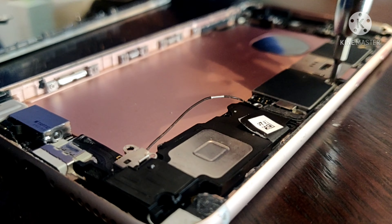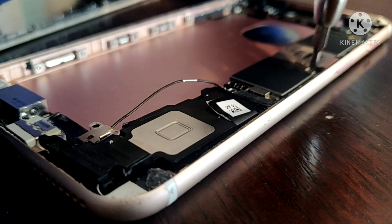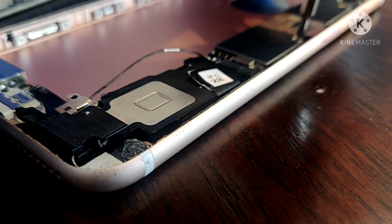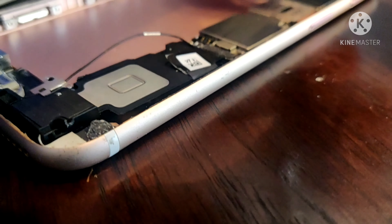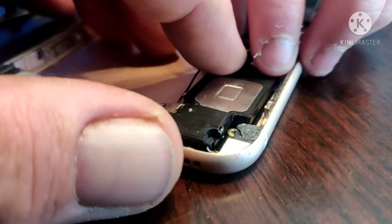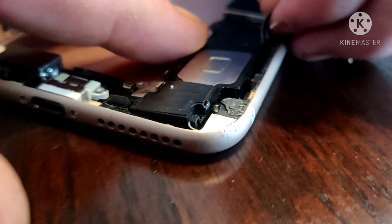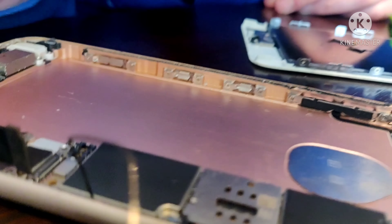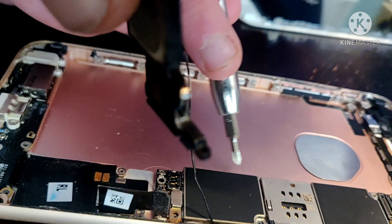If you guys want to see that of course. So you gotta lift up on it — nope, nope, not yet. There we go. Now I'm just going to try to do some of these screws up here and take this ribbon off. We're just going to work on the loudspeaker for now and then we'll do another part to the video. Lift that out — and usually there's a screw that goes down, we didn't have that one. Point that hole out and show them — right here on the loudspeaker bracket. See the hole going down? Through there, that goes right here.